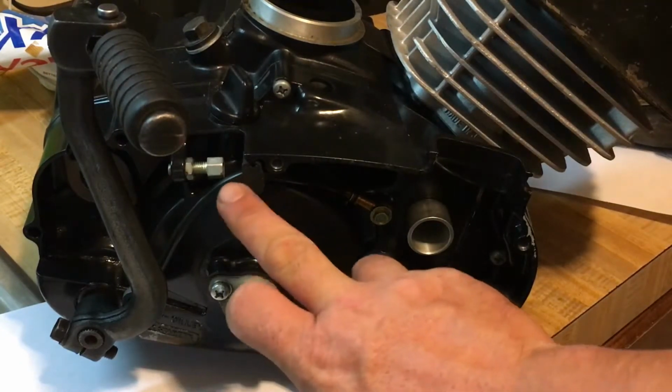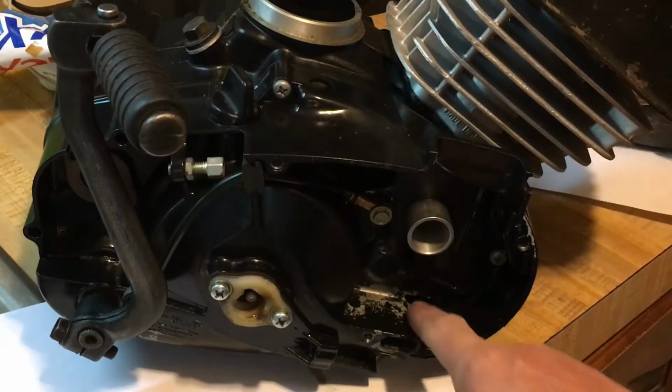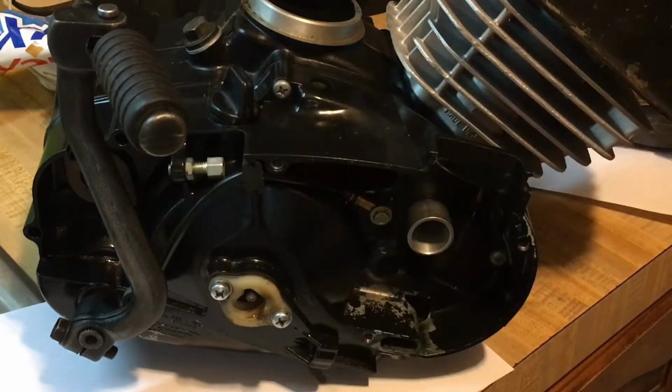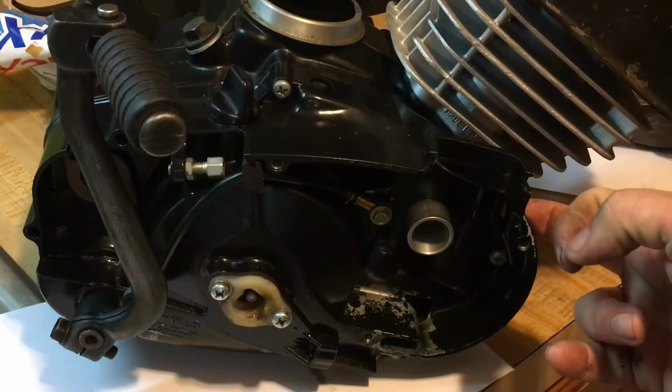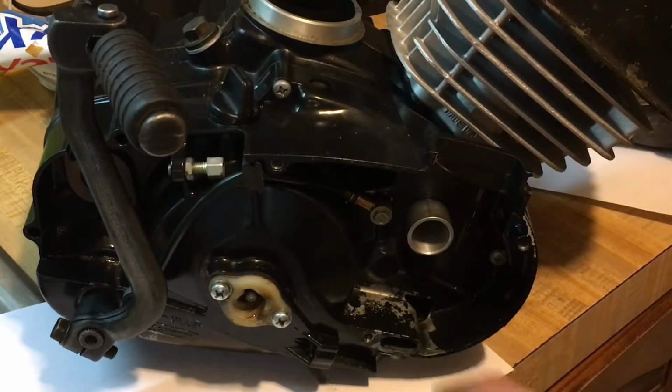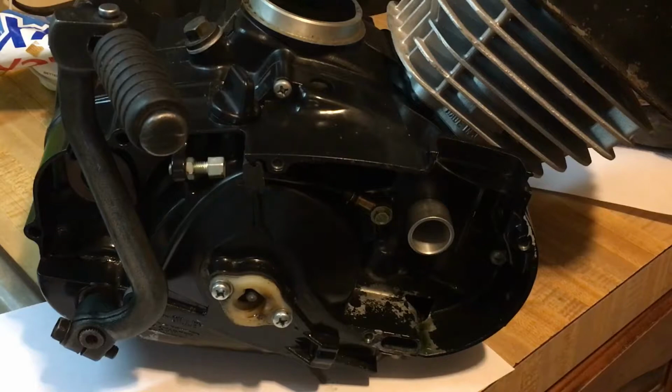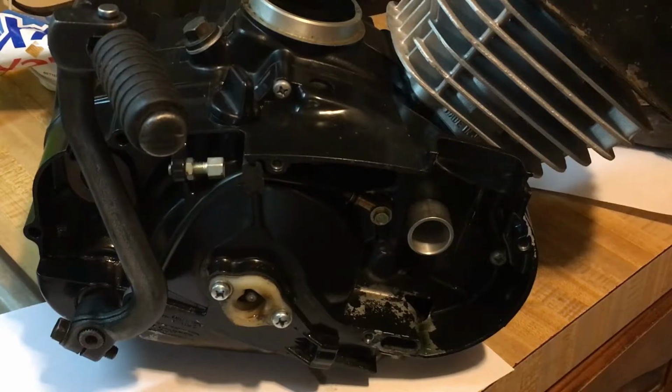That is why you have to have your grommets, and I always stress this. The four places: the grommet here, your grommet for your fuel line, your plug for your intake, for your carburetor, and then your filter down bottom there. So it's very imperative that you have those things in place, because your engine could run lean if any of them are leaking. So this is an air box. It needs to be a sealed unit, kind of like on your car.